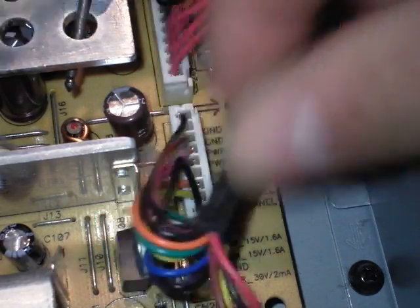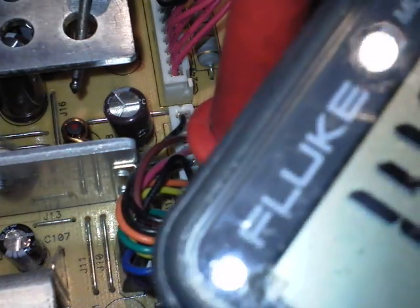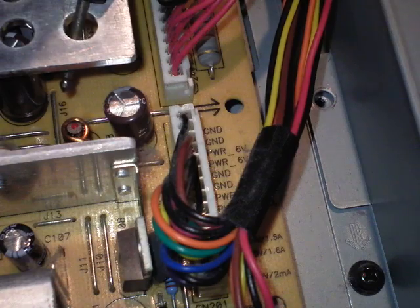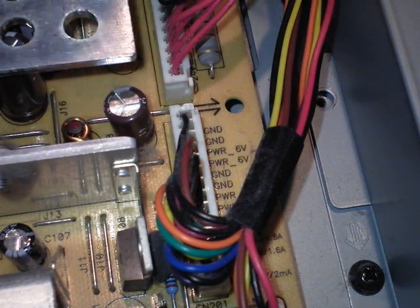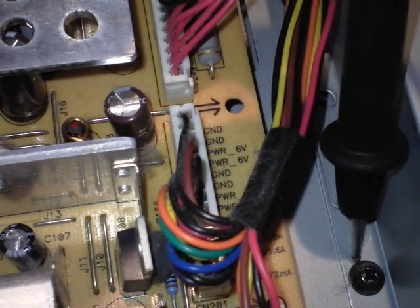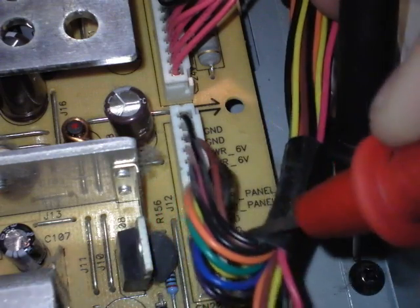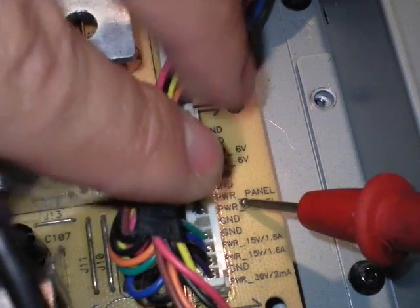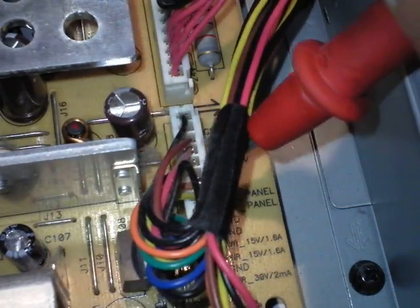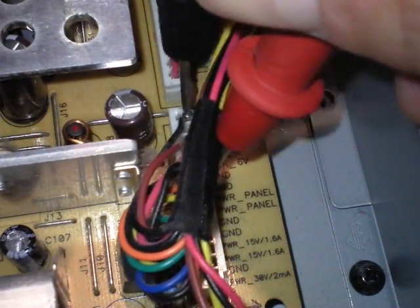This one right here says 15 volt where my thumb is. Let's go ahead and read that — and that's a little low, but it should be okay. This one's reading a little bit low, just 14 volt. Another ground, by the way — you know the screws near the painted screws — that's not going to work. You could touch right by the screw to read the voltages. And there's another one down here, and this is actually the power to the panel. Touch that right there with the ground, and that's reading 12 volts DC.